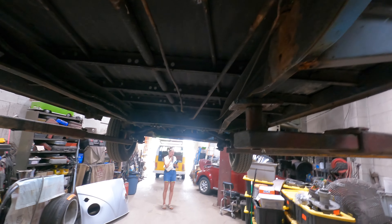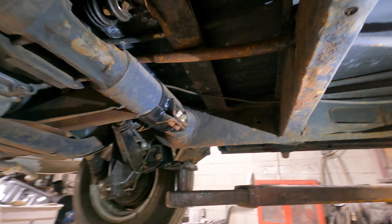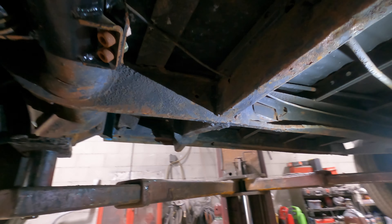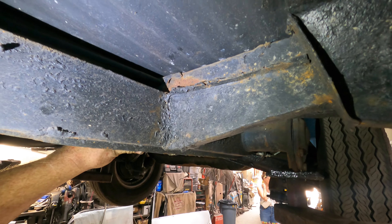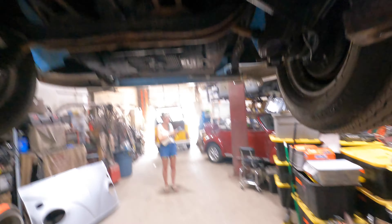I feel bad about all this — it just makes everybody look bad. Do you know if this was done in Brazil? Yeah it was. Even these support panels — look at this, the welds are really not proper welds, it's bubblegum. They didn't clean the metal. When you weld you have to have bare metal to get penetration. They just put it up there — it's all filtered, it's supposed to go here to here, and it's just moved.